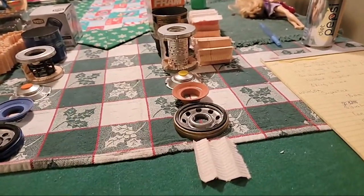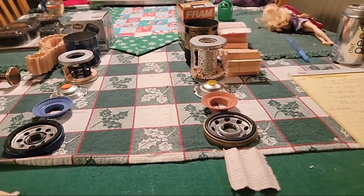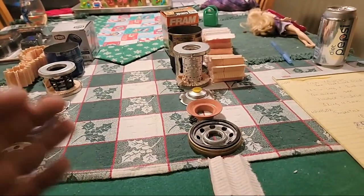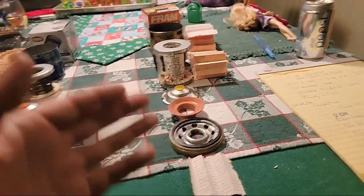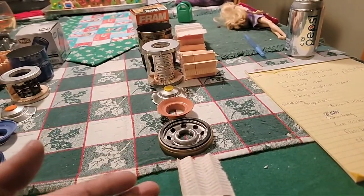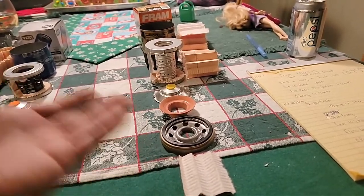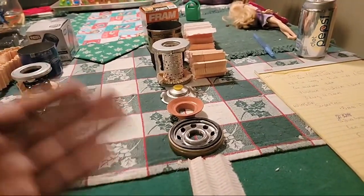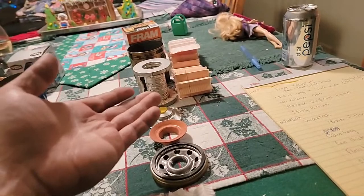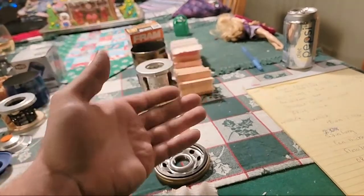And then everybody on the internet was complaining about it, saying, oh, the metal's not in there anymore. They ruined it. They changed it. They destroyed their filter. It was such a great filter. No, guys, if you back off for a second and pay attention to what's going on, they've increased the amount of filter inside it, and they increased the efficiency at 15 and 10 micron rating by doing so. They've given you a better filter. They lightened it up, and they created a better product than what they had before. It's not that they ruined anything. You just took the metal out and added more filter material in and went from a fully synthetic to a synthetic blend. And the synthetic blend is actually what helps support that synthetic material on the outside.